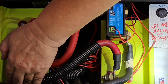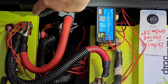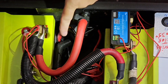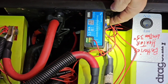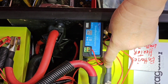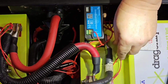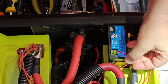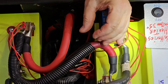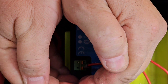We have both batteries connected in parallel, black to black and red to red. The coach red cable from the mega fuse connects to the positive terminal of one battery, and the coach negative runs under here and connects to the system side of the shunt — which is the negative from the other battery. So you connect the negative of one battery and the positive of one battery to make your coach connection. There's a little power cable for the shunt, and you can see a little blue light flashing that tells you the shunt is working.